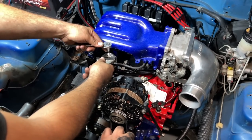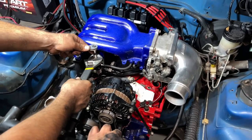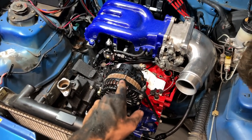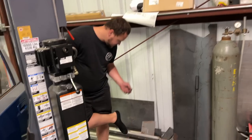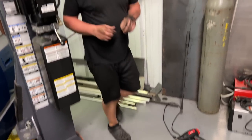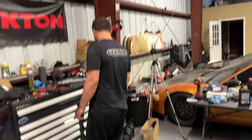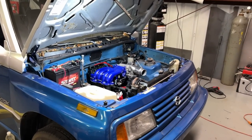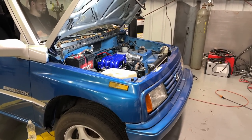I can't believe how much work we've gotten done in the last day and a half. TPS is reading, coolant temp's working, all the injectors are clicking, coils are all plugged in. We just got to screw in the feed line for the fuel, finish the return line, make sure it primes, and sync the trigger wheel timing. The fuel pump from the MR2 sounds a little rough — it's been sitting — but she needs some gas ran through her. Moment of truth: we are ready to crank this thing on and see if she fires up for the first time. It's about 2 in the morning.